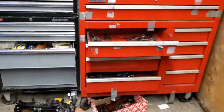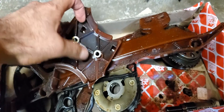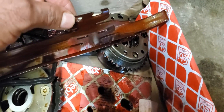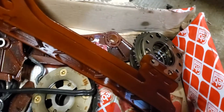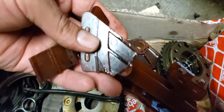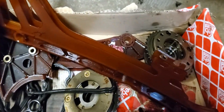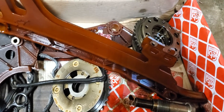What happened to this car is the upper timing guide broke into three pieces — one broken from here, one from here. BMW made this trouble for themselves and for people. You can see it's very thin. I found all three pieces luckily in the engine — nothing gone into the oil sump or oil pan — and I safely removed them.